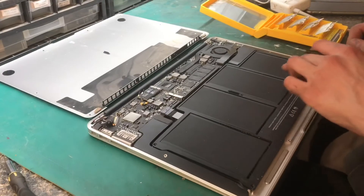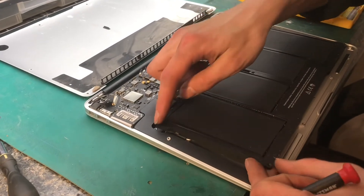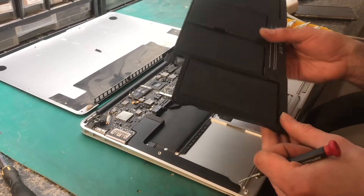Four cells make up the battery, and they're held together in this unit here. First, you want to unplug the battery from the motherboard, then remove these four screws in the center, and the whole thing will just gently come out like that.